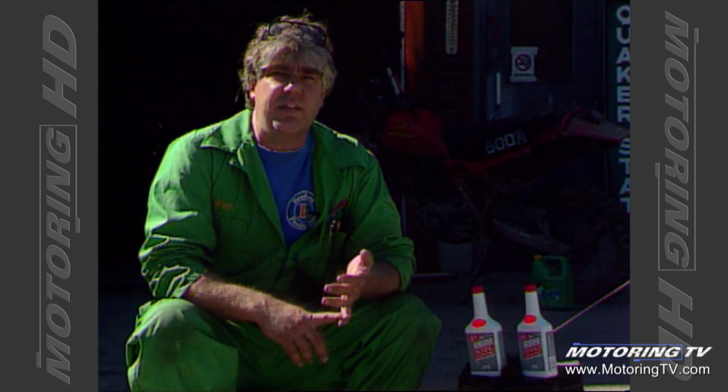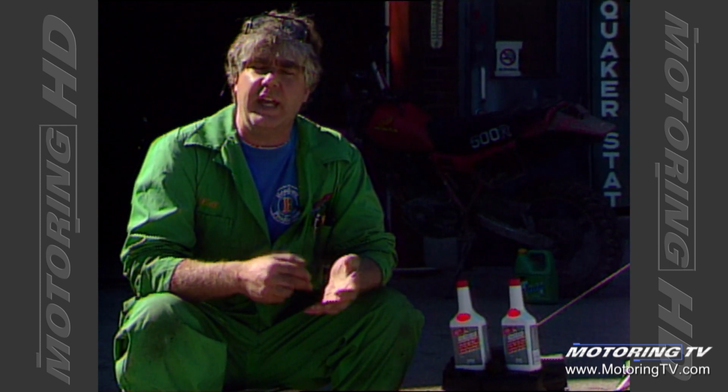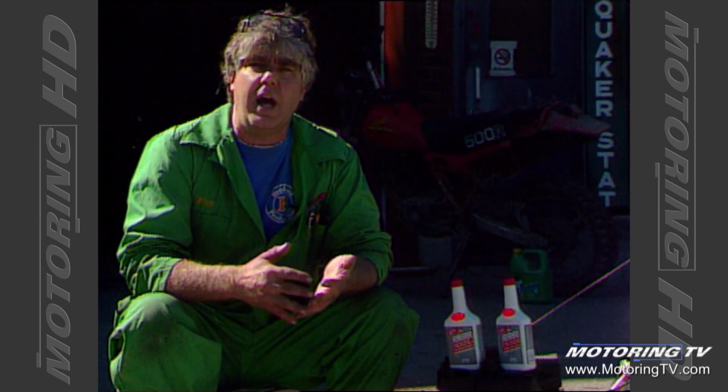First of all, they blend it seasonally, so if you're using gas that you purchased in the winter in the summer or vice versa, you're either going to experience starting problems or vapor lock, or maybe even both. However, the one thing that I want to talk about this week is the fact that the fuel in that fuel system, if you store it more than 3 months, it's going to get rust and corrosion in it, it's going to get gum and varnish in it.